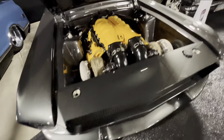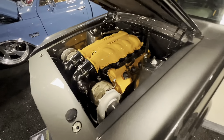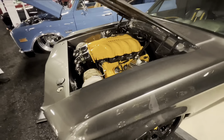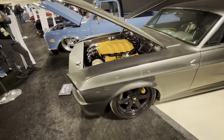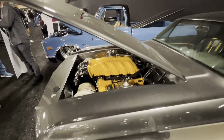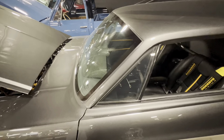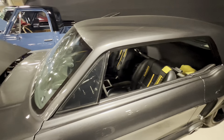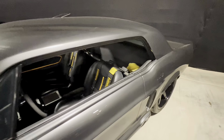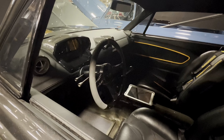This car was built by Tony of American Legends Hot Rods, and power comes from a twin-turbocharged Ferrari F136 4.3-liter V8, taken from an F430, making somewhere in the neighborhood of around 700 horsepower. He had to use a Ferrari California intake, as the manifold layout of the F430 did not fit quite correctly, and it uses a standalone ECU to run everything, mated to a six-speed sequential transmission.